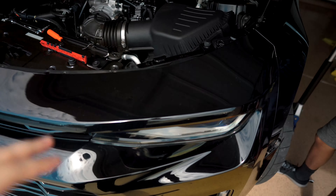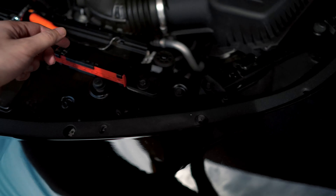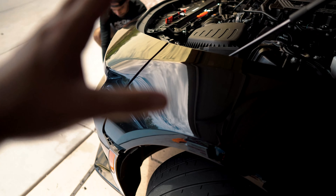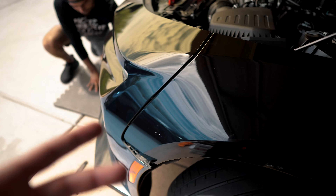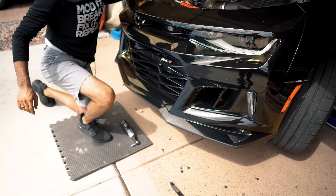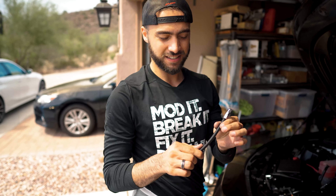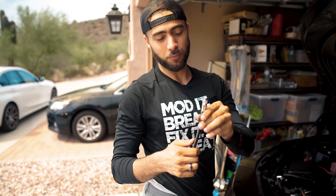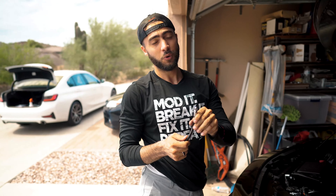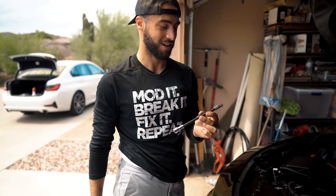When removing the front bumper, start with all the screws up top — there are also push-in clips, so make sure you have the right tool to pop those off. A unique trick: you can reach the top bolt from up top without jacking up the car using a bendable metal extension you can get at Home Depot. It's not rubber — it bends enough to let you torque and unscrew without turning the tire or using a lift.